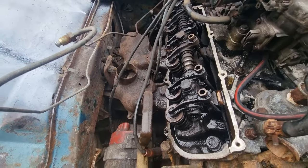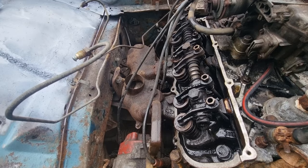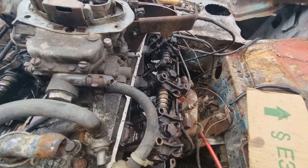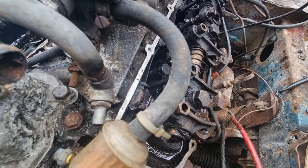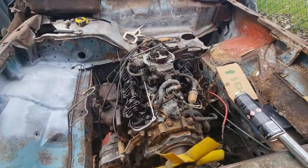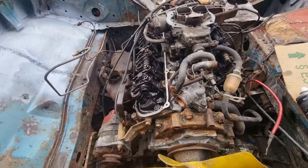After spraying WD-40, spraying some oil down the cylinders with a syringe, and spraying cleaner all over it, and tapping the rockers slightly when they decompressed — I've finally got it free, and it's now doing a full rotation. Phew.